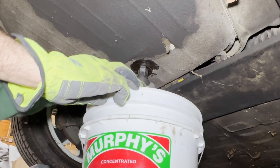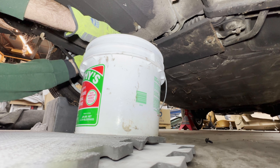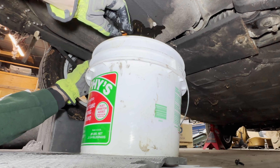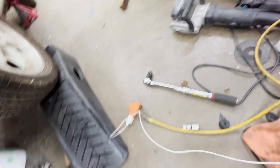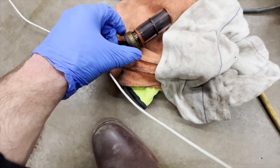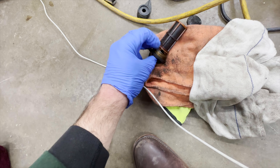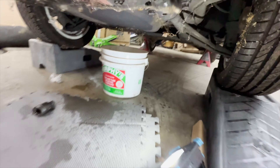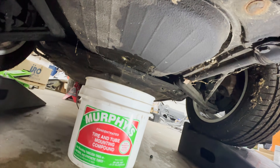I hope there's not more fuel than what I have in this bucket — that would suck. Yeah, it's going everywhere. Check this out. There's that strainer at the end of this drain plug and it's nasty — not surprised. As this is draining, I'm going to add some more fuel to get any sediments floating around in there to drain out as well. There wasn't that much gas in there, which is good. I'm going to just throw some more in and then plug it back up shortly.